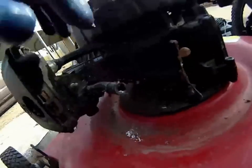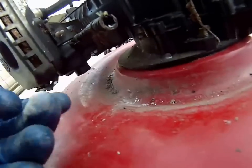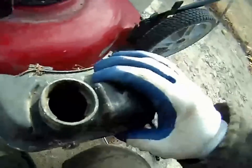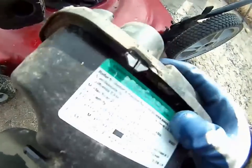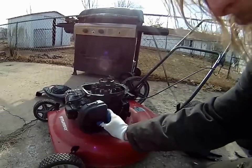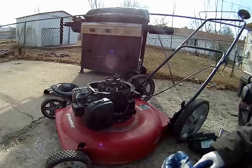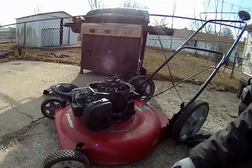Obviously my original cleaning was not good enough because there's a bunch of that Spill-Sorb — which I've been informed is not pumice, but I still think it's probably made from pumice — and that's clogging the line. There's also a bunch of stuff still in the tank, so we're gonna have to give this a good flushing. It looks like I can split this tank in half and really get down to it. There's also a fuel primer bulb that looks like it's blowing residue out when pressed, so I'll have to take this off too. This is the air filter — I'll remove this.